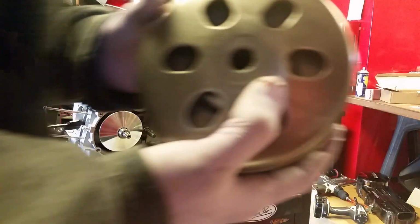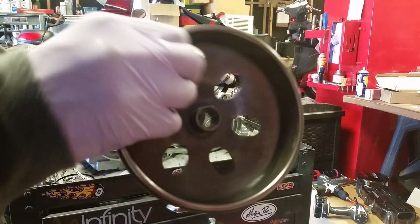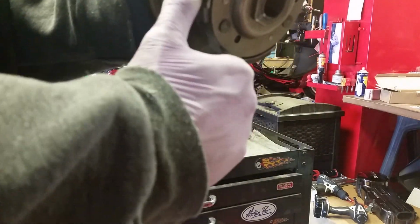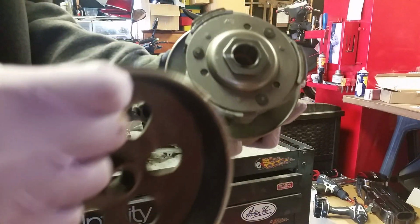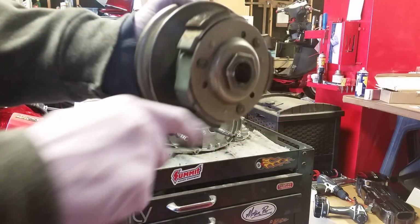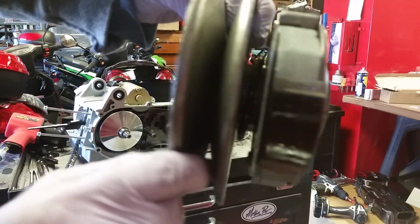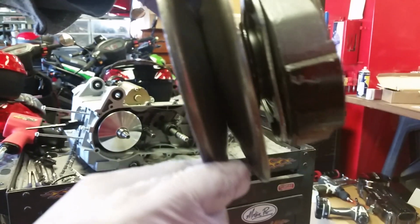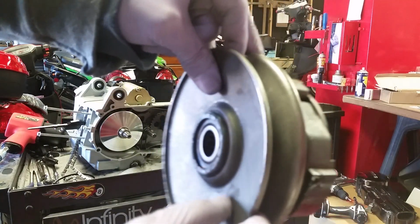And this is your clutch. This is what's known as your clutch bell housing. As your clutch turns, these pads expand outwards, make contact with the surface in here. And that's what engages and makes you go. That spring I talked about, I don't know if you can really see it in there. That's your torque spring, the one that my finger is touching. So this is it. This is your clutch right there.